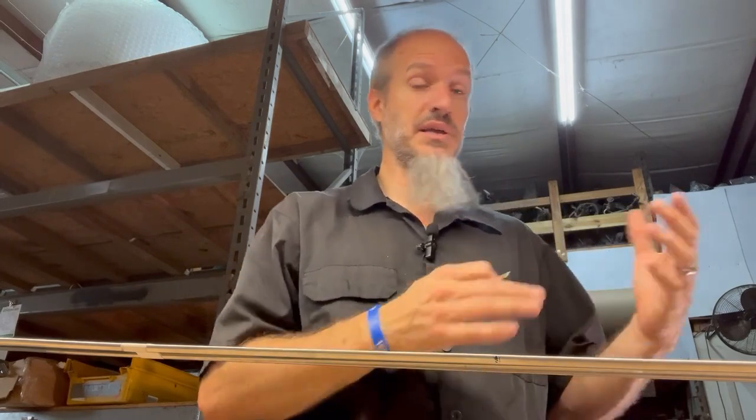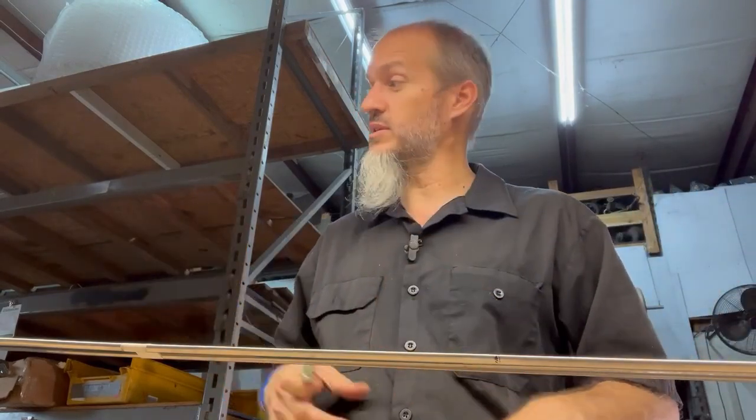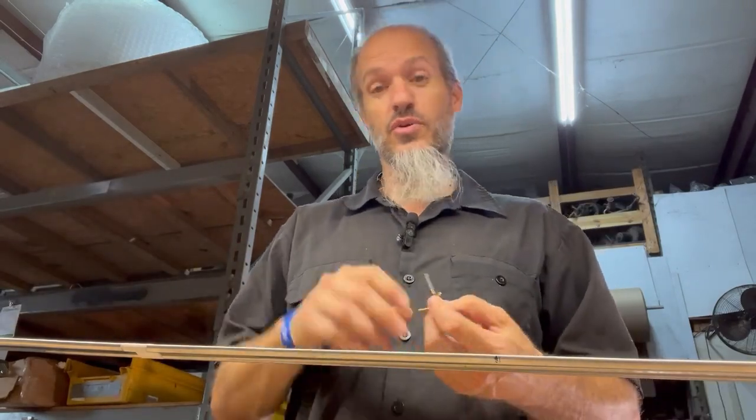some specialty clips because not only is there a concave shape to the molding itself, which makes it very complicated, but it also tapers. So you've got larger clips at the front, on the door, and the start of the rear quarter, and then as you move down, you've got a medium-sized clip, and then you've got smaller clips all the way down at the bottom, or at the end, I should say.